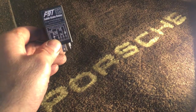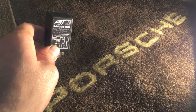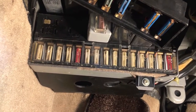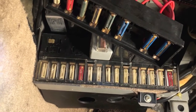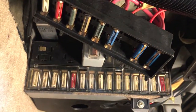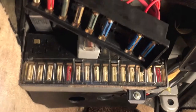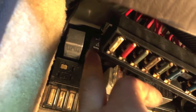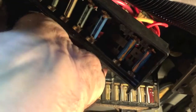So that's a really great feature and we're going to replace it. But for an 83 944, unlike other models, your fuse box is up underneath your dash, right there at the driver's side. First thing you have to do is get a Phillips screwdriver and unscrew this box right here — it's two Phillips screws. You just remove those, this hangs, and then you can reach your DME fuel pump relay. You just pop that bad boy out. Comes out fairly easy with one hand.